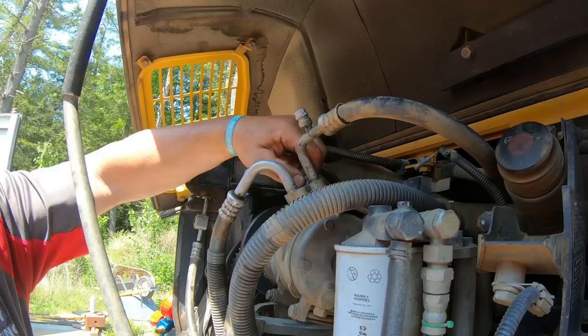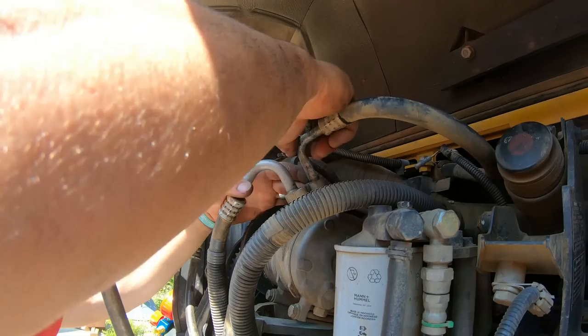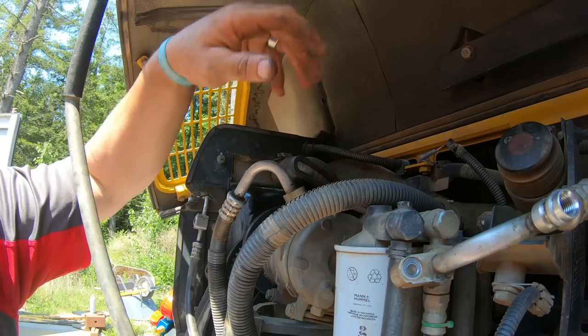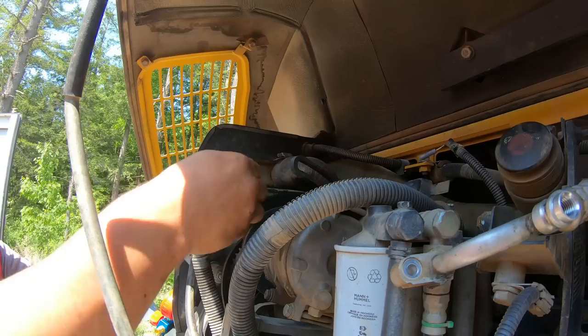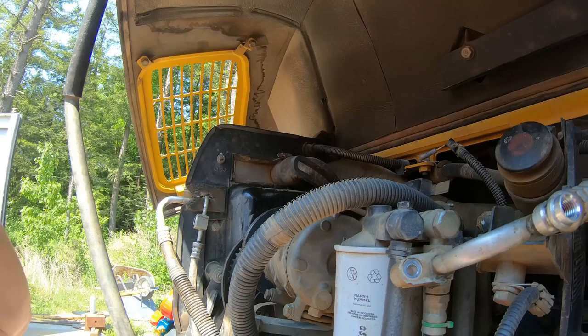It's hot out, but that's actually good — you get better readings on the gauges when the temperature is hot. Pulling these lines off, be careful because there are o-rings in there. After this, the whole system will be new besides the evaporators and radiator. We already pressurized the system and there were no leaks, so let's just pull this off and see what's going on.